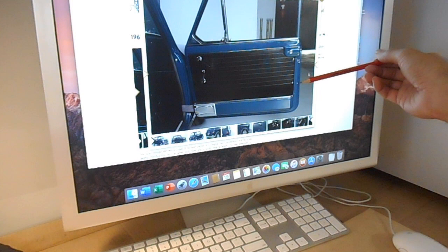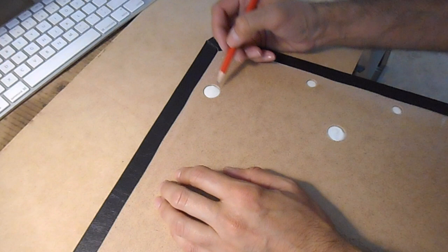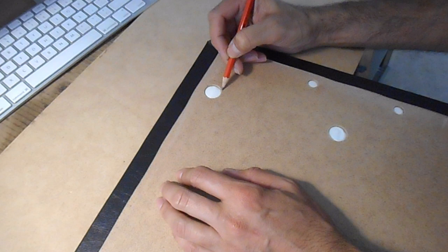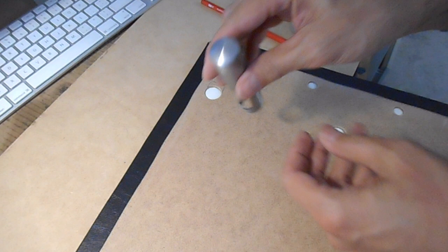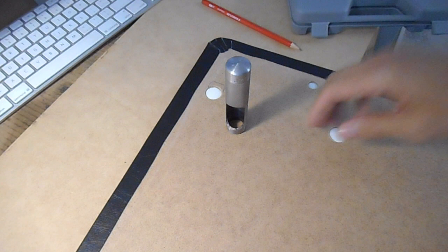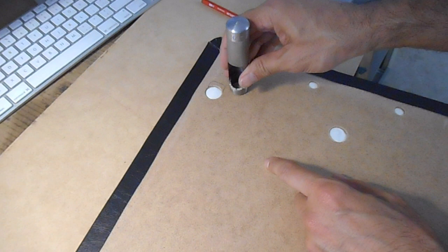These door cards come with a hole already made in them, and there are two holes for the plastic clips that go behind these two bits here. I didn't need to put them on the left-hand side because it holds itself in place. There are also two screws but no holes for those — they're just self-tapping screws into the door. I just need to modify this hole because it needs to come out about to here. The way they get holes in there is with hollow punch — you put that on there, hit it with a hammer and make a hole. But because this has already been covered in trim, I'll mark it out with a Stanley knife and use a pair of pliers to pull up that section rather than risk damaging the trim.